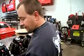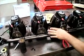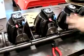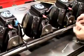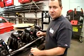And then as the wires build, you start with 2, then you add 2. Now you go to the next size bigger heat shrink, and then you add 2 more. You go to the next size bigger heat shrink, and so on and so forth. It'll be bigger and bigger and bigger, which at the end I'll end up with 1/2-inch heat shrink.